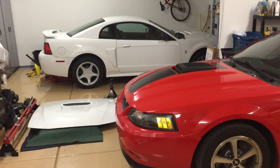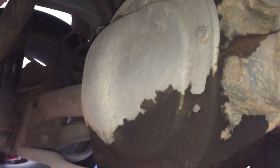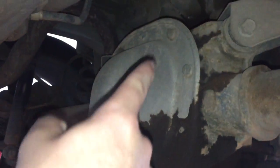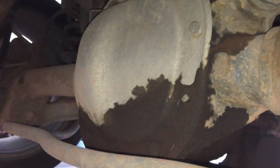One of the biggest mistakes people make when looking at their rear differential is they see it's moist and caked up at the bottom and assume it's just the gasket for the rear differential cover. But if you follow and see that it's wet up the front, that tells you it's most likely the pinion seal on the other side where the driveshaft ends. It leaks down and accumulates at the bottom, so proper diagnosis is very important.